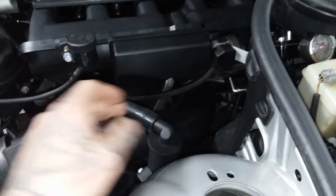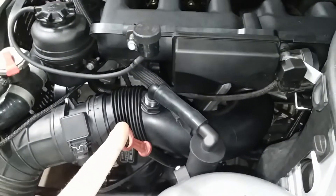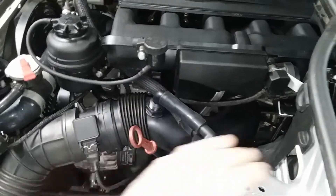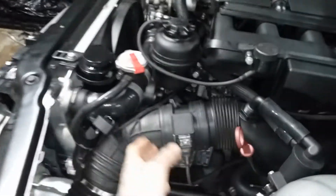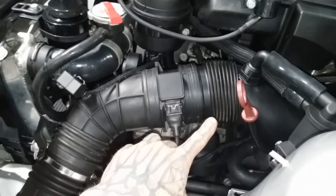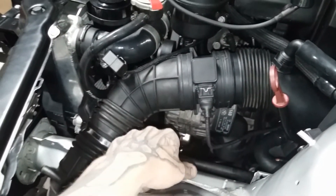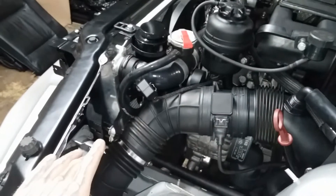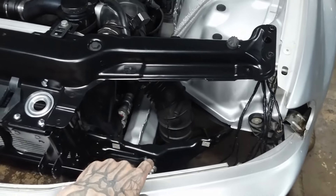It's nearly a mandrel bend, meaning it's mainly smooth the whole way across the intake tract besides this rib section here for flexibility. Overall it's a very nice size intake tube and it fit very nicely with my other mods. We're also running a 3.0 mass airflow sensor because it plugged right in size-wise. We're also running OEM E46 intake boots, basically using them backwards from how they're originally meant to be used — two of them to route down behind the headlight and behind the front bumper for colder, denser air. It's basically a full OEM cold air intake.